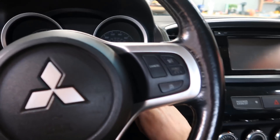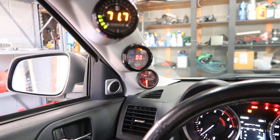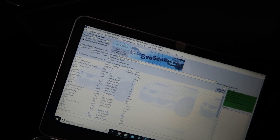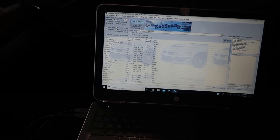We'll do a quick test to see if the wideband is actually working. I'll click Start Data Logger — you can see the wideband reading 14.3, 14.4, so it is working. I'll stop that now. I'm gonna go to a stretch of highway where there's not too much traffic, start the log seven seconds before I start the pull, and keep it logging seven seconds after the pull. That's what he told me to do.